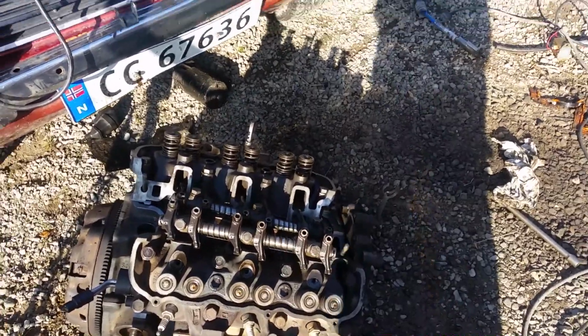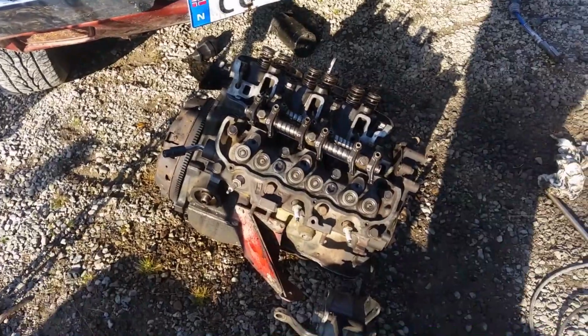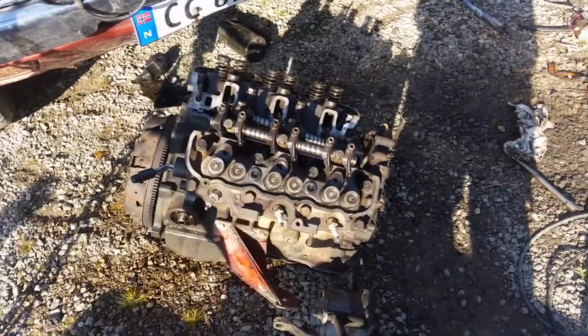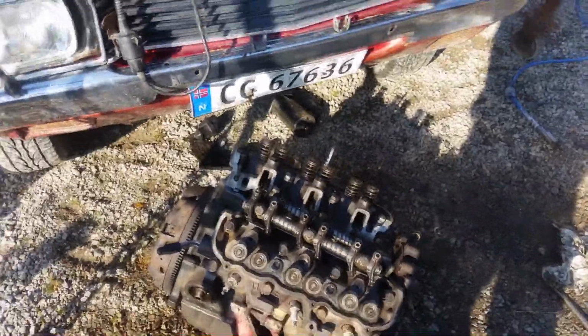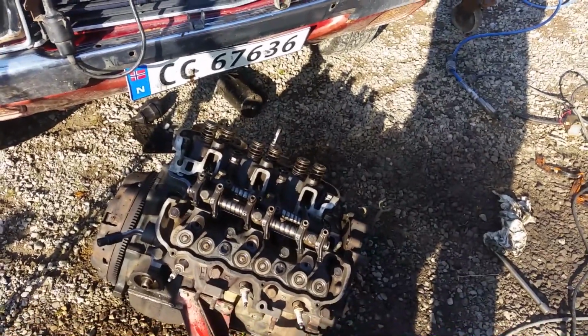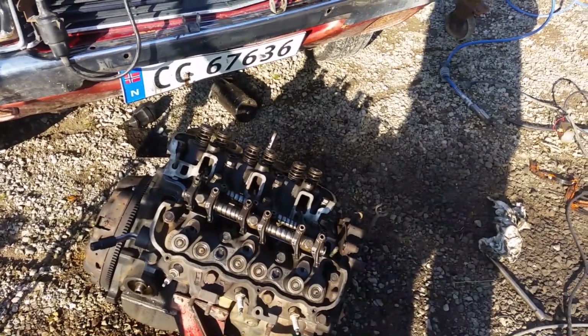So I bolted that on the other side. Of course, I have to put the oil filter on. I'm not going to do that until I have the engine in the car, because the exhaust on this side runs right over it. So I'm guessing it's going to be easier to guide everything in the right way with the filter off, so I can get the exhaust right around this place. So I'm just going to torque up those heads on the last stage now. Then clean up.